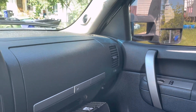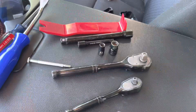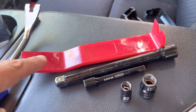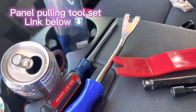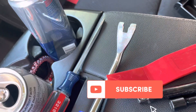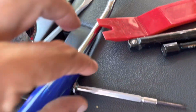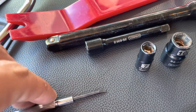I've got a ton of tools here that I'm going to be using. To get the door panel off, you're going to need a 10mm and 7mm socket with extensions, a plastic panel pulling tool — this is one piece from a five-piece kit — and also something metal like this. Here's the part number from NAPA; this will save you a lot of grief pulling the plastic snaps that hold the door panels on. You'll also want a flat head and a really fine sharp one.